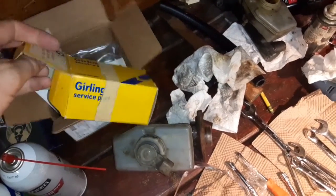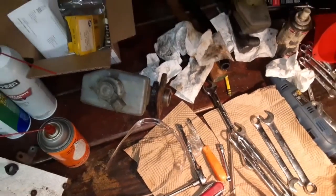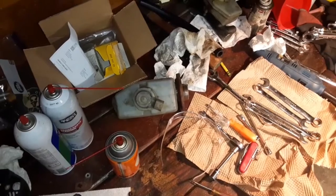Next up is to install the master cylinder from the 1986. I bought something on eBay that was supposedly for the booster — the master cylinder is supposed to have an O-ring that fits in between the master cylinder and the booster, but it doesn't seem to have come with that O-ring. So I am going to have to get an O-ring kit and figure out what kind of grease to put where the dowel or lever pin that actuates this goes in, and then put that together and start bleeding.